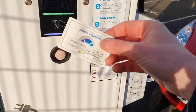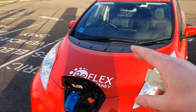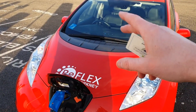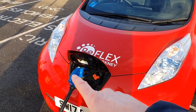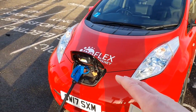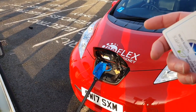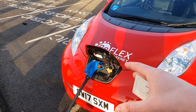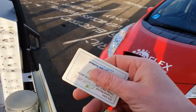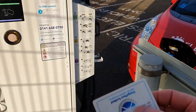No one can stop your charge unless the original card is presented to the charger. Now, should you arrive and someone's car is connected — say you went to the shops and lost track of time — once this rapid has filled the car it will actually stop charging. That red light on the handle will go out and both lines will be green. If you pulled up and saw a car connected with the light out and both lines green, you couldn't hear it charging — the car will automatically release the cable. It is quite okay to unplug someone else's car if they're finished charging, shut their flaps, and start a new charge with your RFID card.